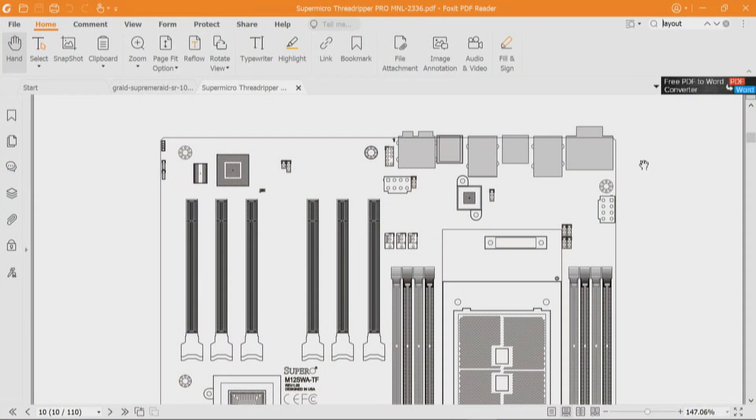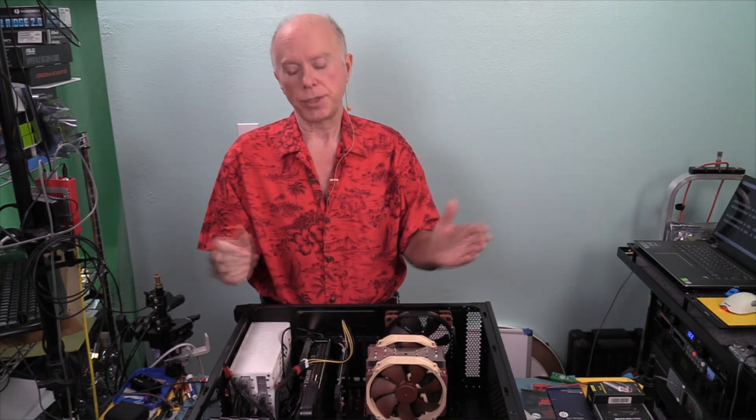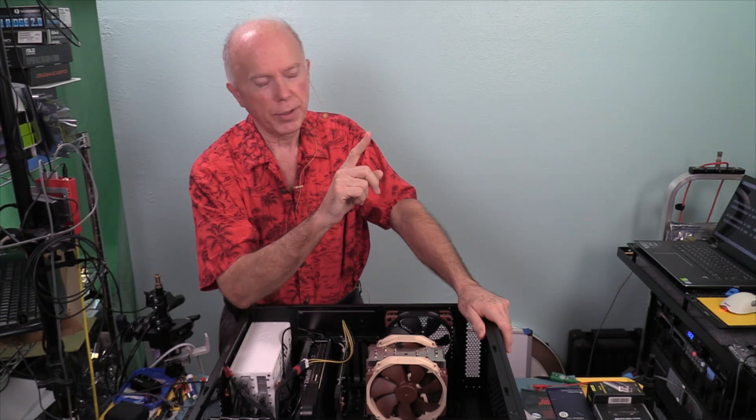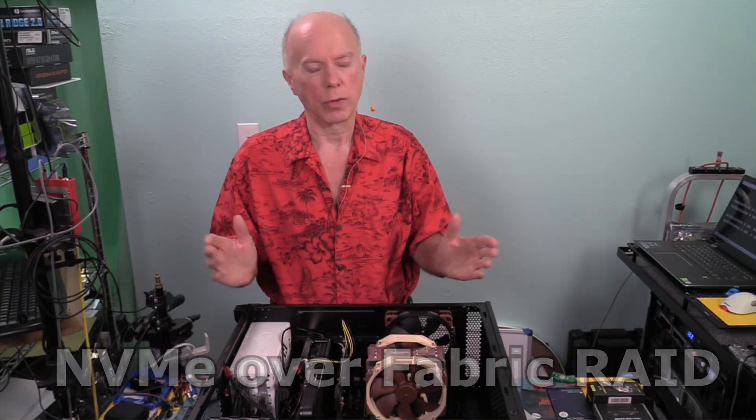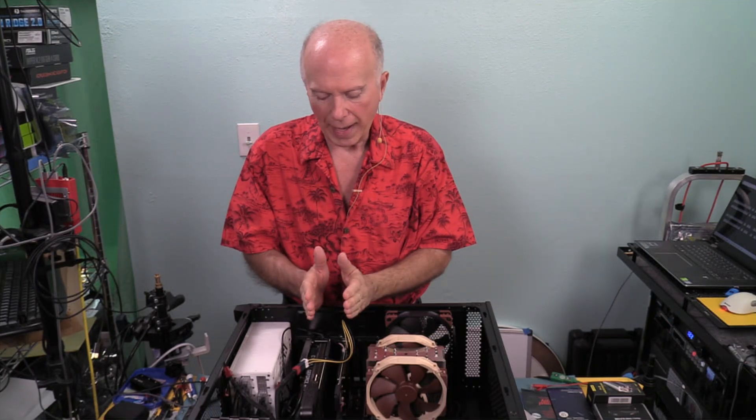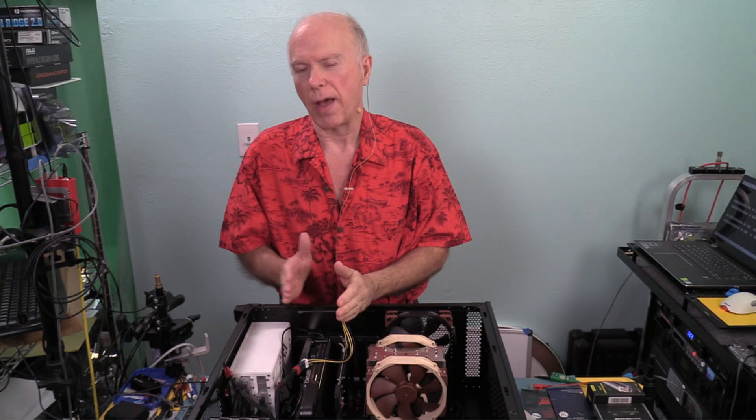Let's look at these three motherboards. The first is from Supermicro — their WRX80. Based on six slots, that gives us four slots for our M.2 NVMe adapter cards, whether four quad cards for 16 drives or four 8-drive cards for 32 drives. That leaves us with one slot for the GPU and one for the RAID GPU. If we wanted to add a Mellanox adapter for NVMe-oF, we need one more slot — and we don't have one. So that motherboard would work, but we can't add Mellanox because we don't have another 16-lane slot. It would be third on my list.